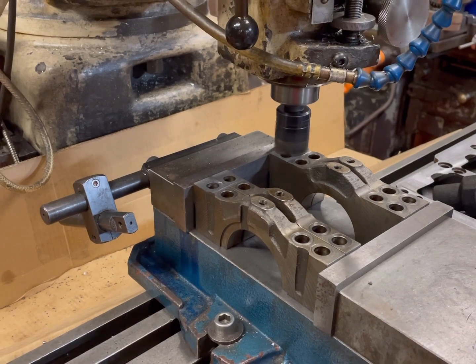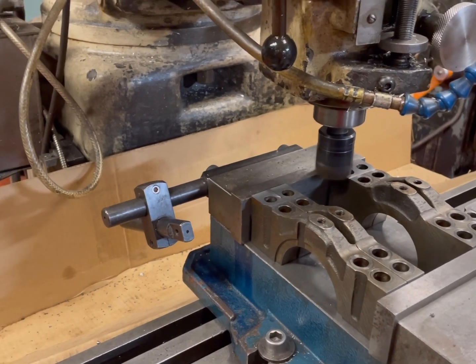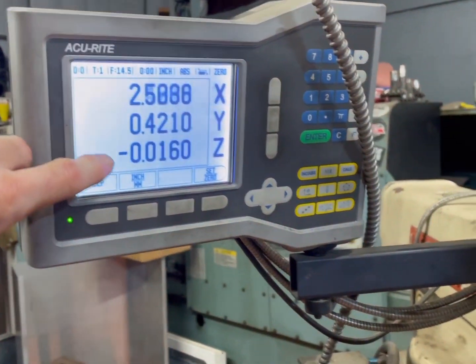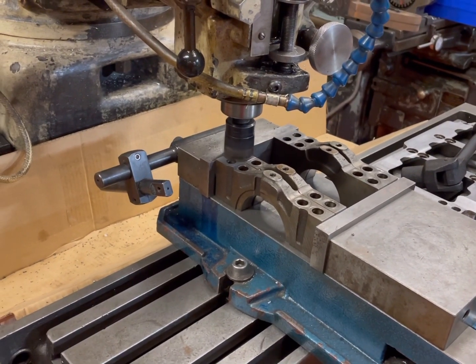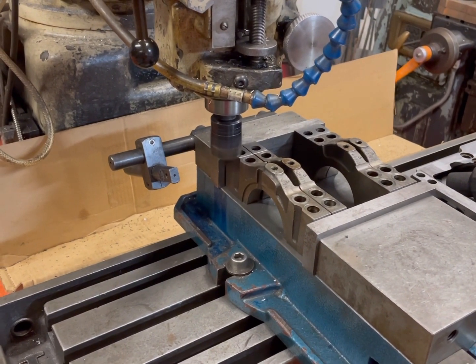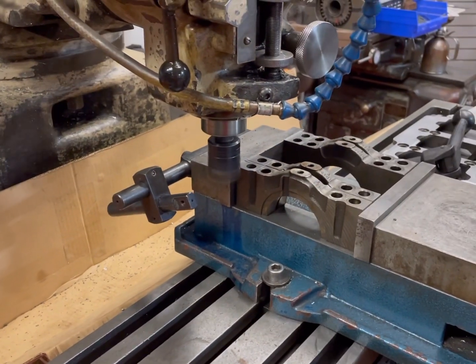The first step to fitting the main caps is making sure that they're all nice and even. We're going to start off by milling off both sides of the cap where you have your four main bolts so that they're all equal height. We want to make sure that there's no uneven loading introduced by differences in main cap heights. Once we do that, we'll move on to the center bolt where we're just trying to match the profile of the girdle. We'll visit this later on in the video.